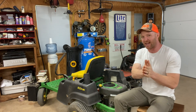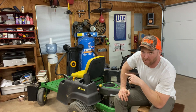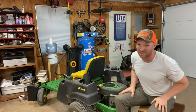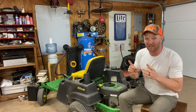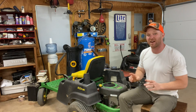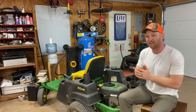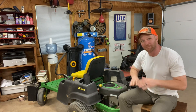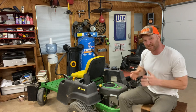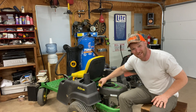So I am going to show you the number one reason that I have found why engines are burning oil on these lawn mowers. And I have worked on a lot of smoky lawn mowers — this is probably three quarters of them. It is the oil level. These motors, especially the Briggs and Stratton single cylinders, are very susceptible to smoking when they have too much oil in them. Because they take such a small amount of oil, a lot of people just want to fill this thing all the way up to the top — do not do that. You can't just throw an extra quart in these thinking it is like your car. These things are very sensitive, very small. So, first thing you do if you are smoking is check the dipstick.